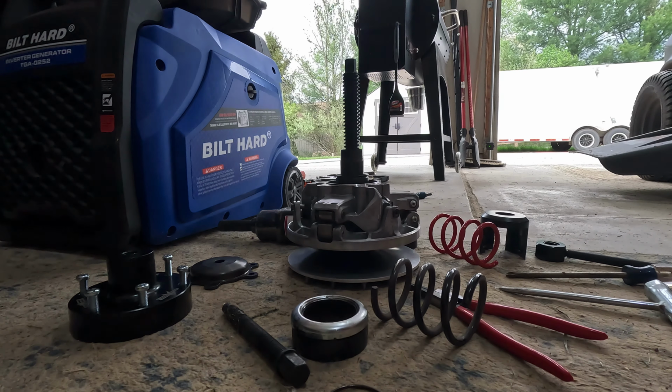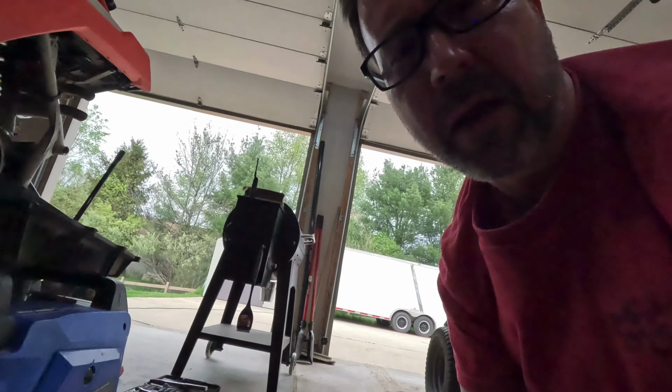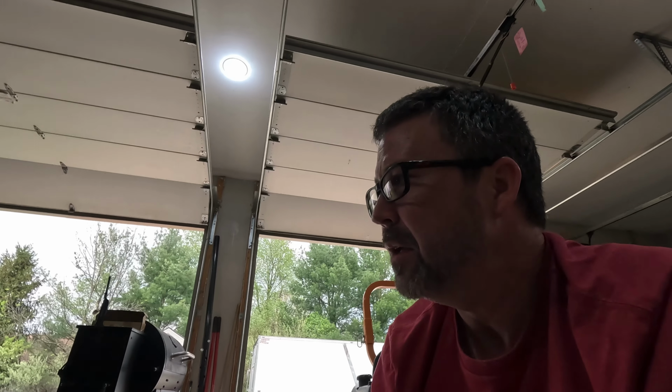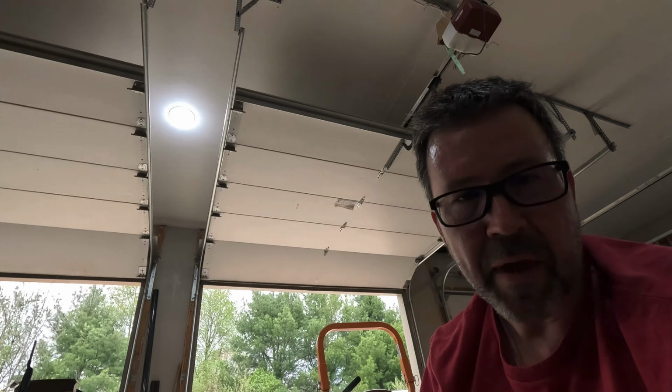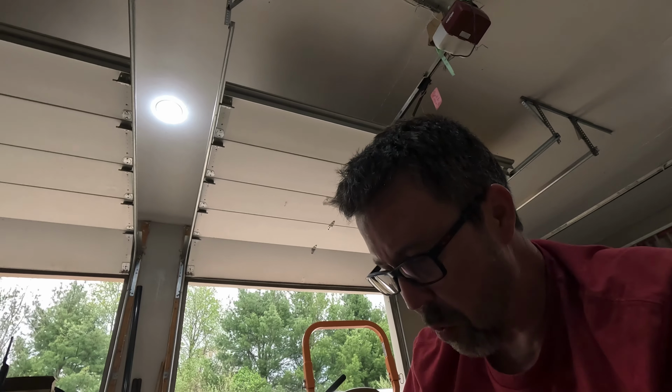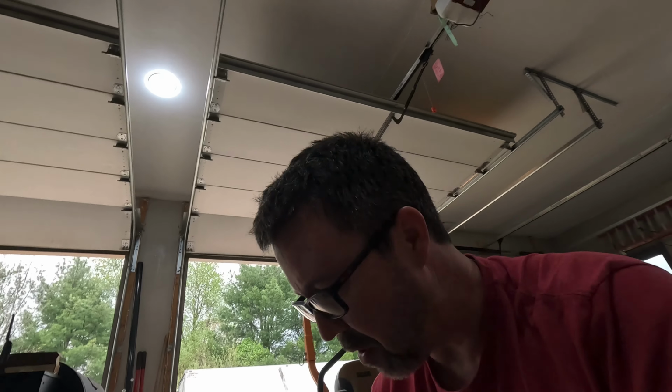Got our spring cap. So now, since we are going to be running, we're gonna keep it low. I don't wanna put too much stress on this. We go racing twice a year. So I'm gonna use Evo's 2300 two-step launch. Even though I have the choice to do it adjustable, I'm gonna keep it there because if you wanna go higher than that, if I'm not mistaken, you have to upgrade your P drive.